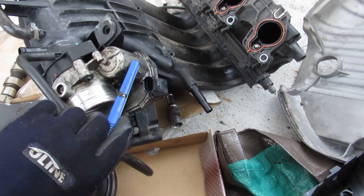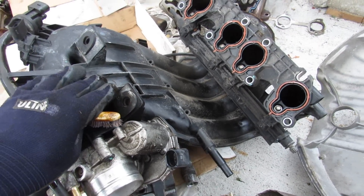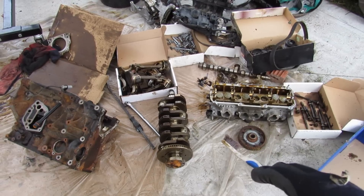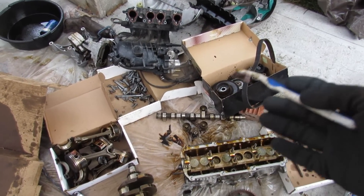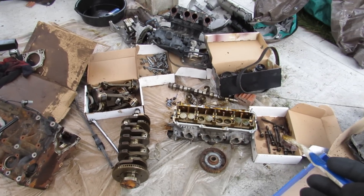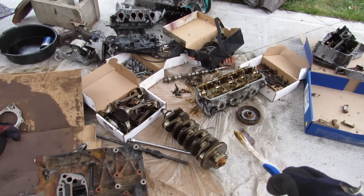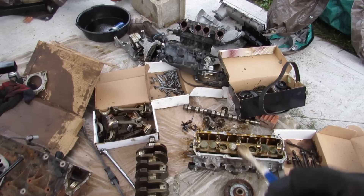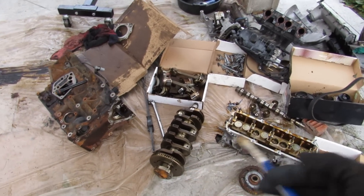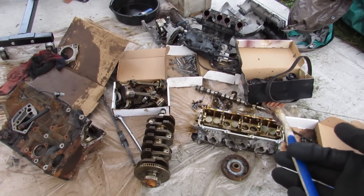Looking at the air intake system, the only modern technology I really see is a drive-by-wire throttle body as well as an acoustic induction system that has a flap inside activated by vacuum, which varies the length of the intake runners — I do have another video on how that works. For a German brand, I'm extremely surprised at the relative simplicity of the design inside this engine. Everything is very simple, even simpler than a Japanese or domestic engine from 20 years ago. But I guess that's what you got if you ordered a base model Jetta — Volkswagen can put a simple design engine together without the extra complexity of their modern engines, with the exception of using random fasteners everywhere. Make sure you follow me on Instagram to find out what the next engine teardown is going to be, and subscribe for more videos like this one. We'll see you next time!